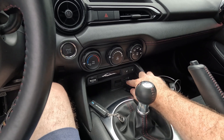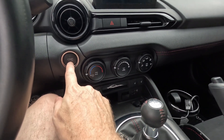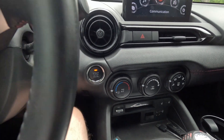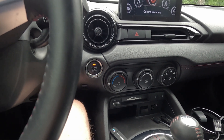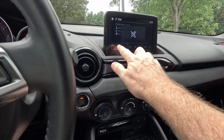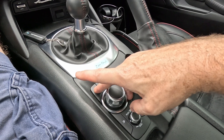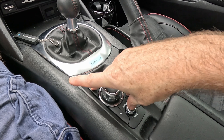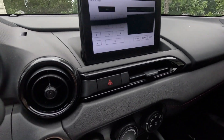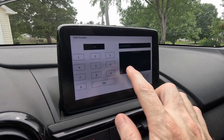With the car off, make sure you have everything disconnected from the USB ports and your SD card out if you have navigation. Now press the start/stop button once without touching any pedals. Shut the door so it quits yelling at me. Wait for the Mazda Connect to fully start, then change it to either AM or FM — I put it on an FM station. At the same time, press music, favorites, and mute and hold it for a couple seconds until the diagnostic test screen comes up.